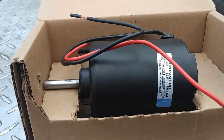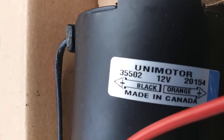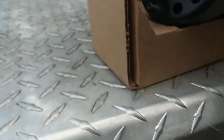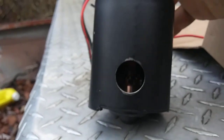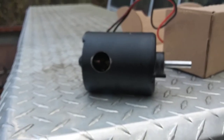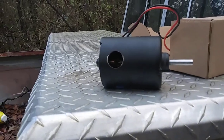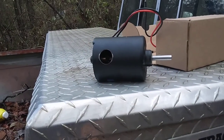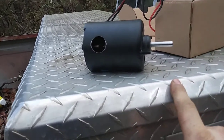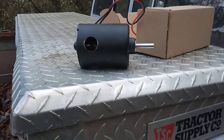Part number 35502 is supposed to fit the 78 Ford — and it will — but when we open the box and take it out, it's got that hole right there. So it was actually made to have that tube point. All that is, is to self-cool itself — as that fan is blowing, air circulates through this motor and helps cool it off.